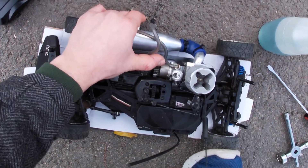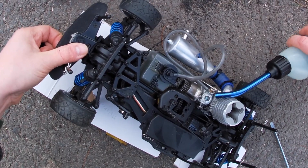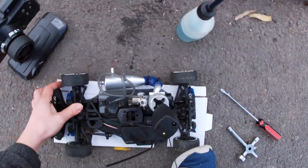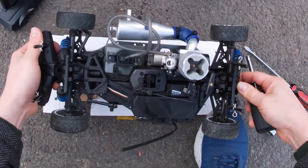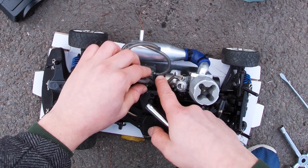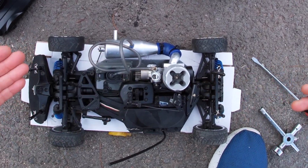You know what, I'm just going to pour some fuel down the carb and hopefully this thing will start. Light is green, glow plug is good. Oh yeah — so it started! And of course it died. I was hoping when it started it would create back pressure and fuel would travel up the fuel line, but the fuel is still exactly where it was. I've got to investigate this vacuum leak situation further, but it started guys — it started!